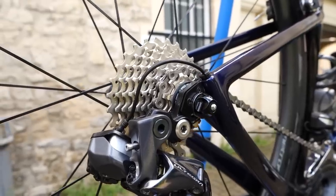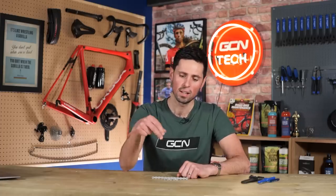The main goal when you're lubricating your chain is to reduce the friction and therefore wear between the inner surfaces that are in contact with each other — between the pins, the links on the inner surface, the rollers, and the inner surface of the outer links. Any of the external surfaces that you can see on your chain, generally, we don't need to lubricate.